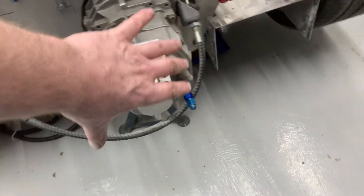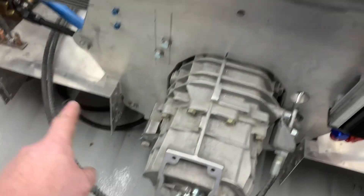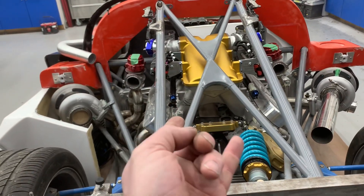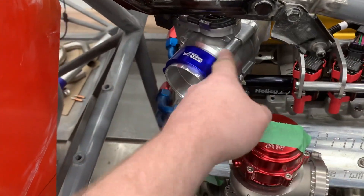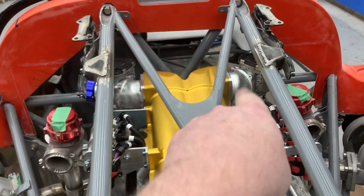The second exhaust box is spaced further back on purpose so the pipe won't be trying to feed through the cables - it'll feed through this gap and down. They're staggered as they come to the back but then form together into two tailpipes. There'll be a feed from the right bank turbo into this exhaust box, which crosses over and comes out the left exhaust pipe. We'll have an in to a box and an out to a box very close together, with a bypass valve. If you want to be rowdy on the track, the turbo comes through the bypass valve and straight out the right-hand side. On the intake side, we've machined all the adapter brackets for the throttle body quick release and the 28-degree base plates.